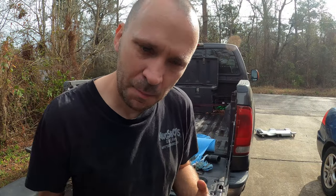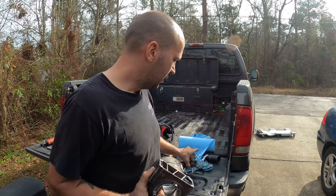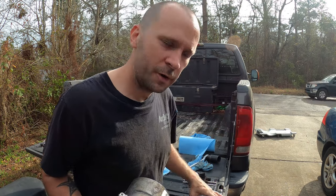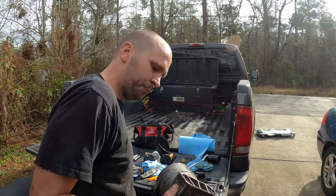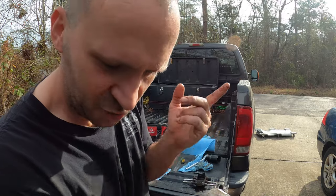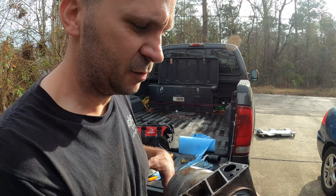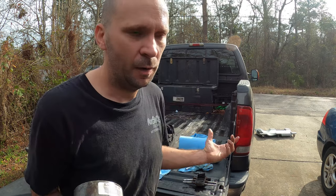Because the inside of mine was so dirty from the bowl, I went ahead and took this side piece off where the fuel lines connect — it was a quarter inch bit on my drill. Look what I just pulled that out of right here. If you're going to be doing this, I would suggest taking this apart and making sure all this is clean before you start putting everything back together, or you're going to end up with the same problem — i.e., low fuel pressure.